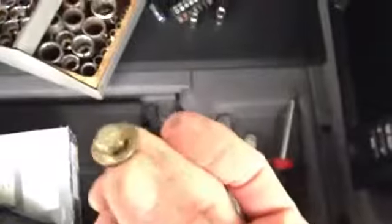I had three of these plastic bolts, two of which held the Trimble to the back of the amp, and then I had all of these 8 millimeter steel bolts that held the amp to the frame of the car. I actually relocated that GPS wire antenna that we're going to want up here. I put it through this little thing so I don't lose it and bury it back there and have to take it out again. But I am going to start that process of putting the amp back in.